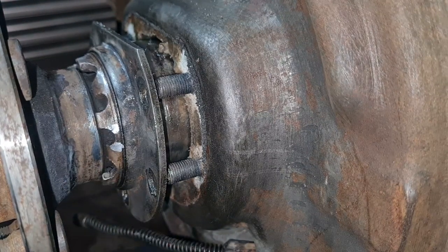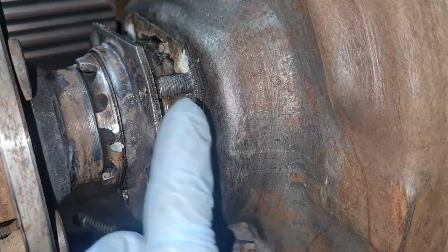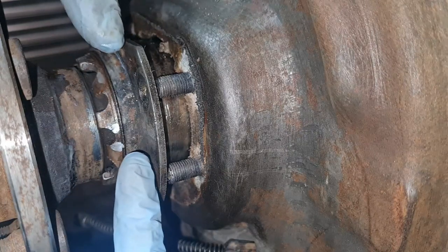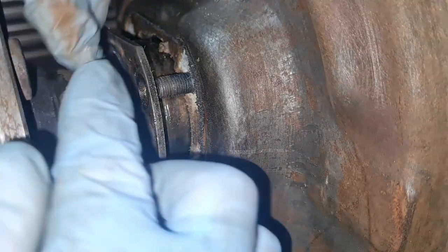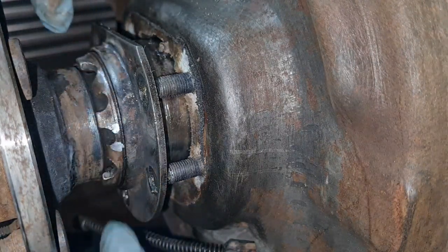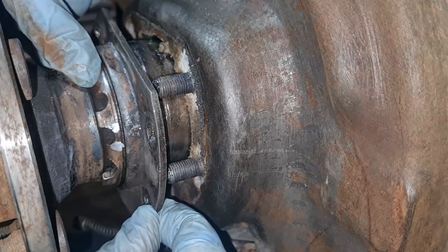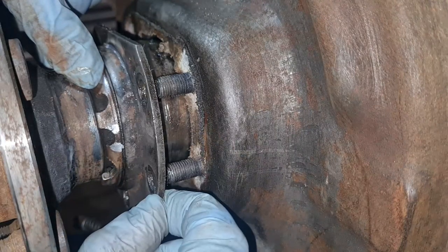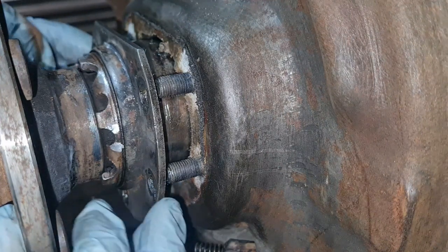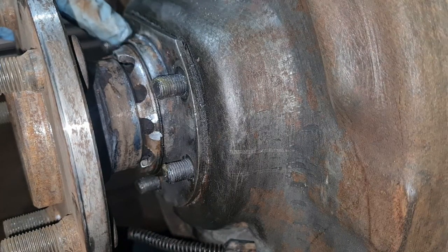That's your adjustment. So what I done, because we weren't actually replacing the bearing or the end stop or anything like that, all we were doing was the inner seal. That's all we were doing. What I ended up doing, after we took this off, I just put some tape around this, this and this to hold everything together all the way around. I put some tape all the way around just so it held everything together. Then whilst I was cleaning, that didn't end up going around here and come out of alignment, because you want the flat top here to line up with this bit, so when it goes in and pushes in like so, you've got the flat bit here because you've got the wheel cylinder just above it here, okay?